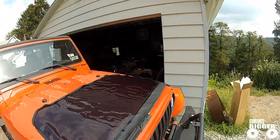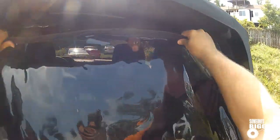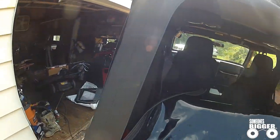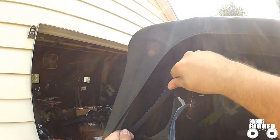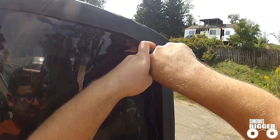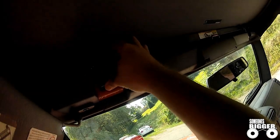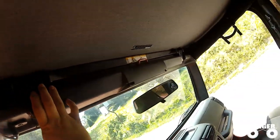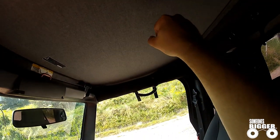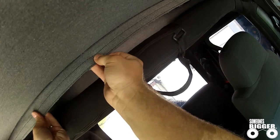Reinsert the metal track from your old window onto the new window by sliding it from one side to the other. Place your rear window into the rear track of your Jeep. Move both of the zippers to the far left corner, then roll the uppermost zipper all the way to the right to close the rear window. Now go ahead and clamp down your front header tracks — you will notice that your top is very tight. Velcro your soft top to the center frame by folding the velcro over the frame and onto itself.